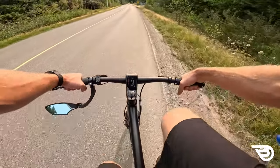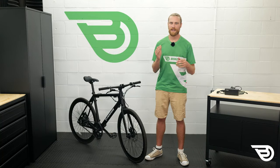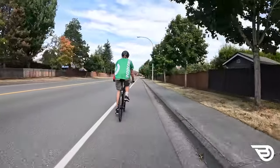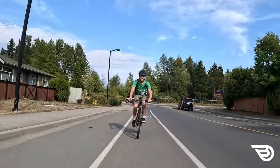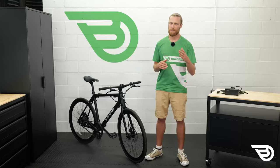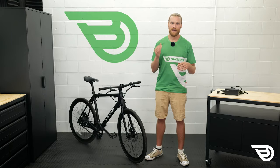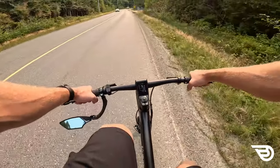Con number two is a loss of power while riding, and this is similar to our last con. This involves the bike's performance as the battery level wanes during extended rides. With a total range of 24 miles, the bike is bringing a similar level of performance that is in line with its competitors. Yet this bike is tuned in a specific manner that is frustrating to operate on longer rides. The controller offers good power and pep at higher battery voltages, so when you start your ride you'll be zipping at a reasonable speed. The bike falters as you cover more ground and the battery dwindles. The bike is already ill-equipped to climb hills with its single speed drivetrain, but it is almost useless on grades at a low battery level. Even on flat ground, the difference in motor ability and output is noticeable and discouraging during a long trip.